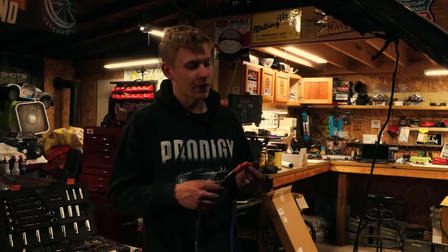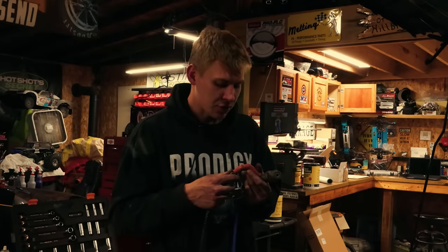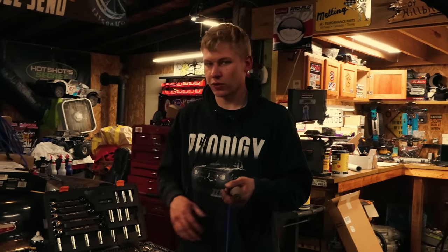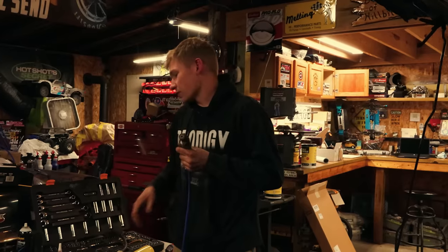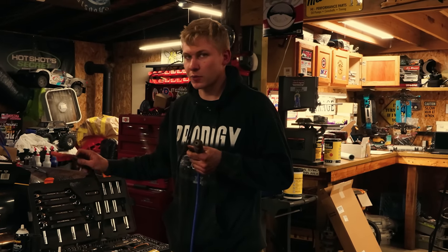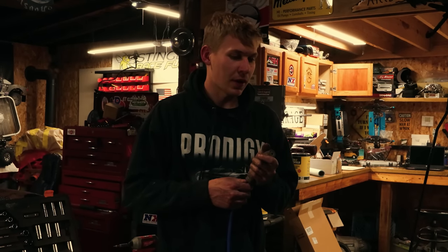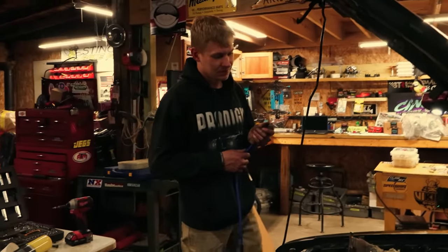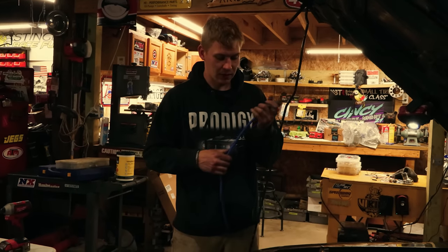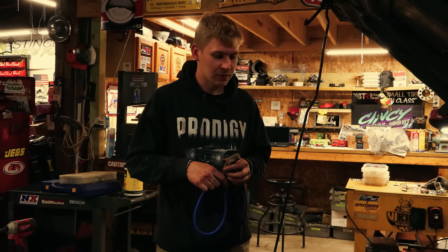So it doesn't work. Well, out here working on the Mustang, about 12:30, got another burnt spark plug wire. So that explains our ignition cutting, or I guess under load, lack of performance, popping and banging out the exhaust. Every time it starts doing that, I got a good suspicion that it's a plug wire. Just the way this exhaust is, it's really close to the plug wires and there's not a whole lot you can do. Thinking about just putting hood exits on it, running them right out the hood, because I'm tired of changing these damn spark plug wires. I got some old spark plug wires off the gray car I'm going to put on there for right now, and at least get it to where it runs good again.